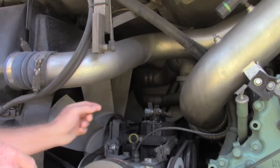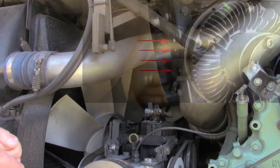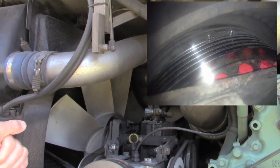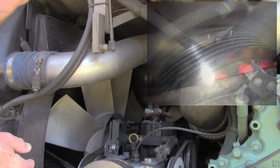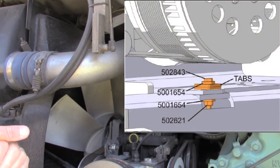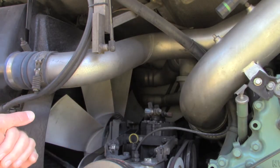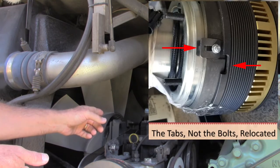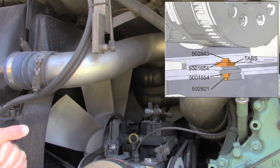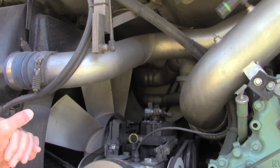That varies with the vintage of clutch, and we'll show some illustrations so you know what they look like. Captive bolts are not always right there — they would have been on the older coaches or those that haven't had clutches changed out yet. They could be up on the frame member, or they could be in a place down on the mount where the bolts are at, and that would be on the newest ones. So if this got replaced with the newest generation fan clutch, those bolts would be relocated because of the orientation and mechanical size of the new fan clutch.